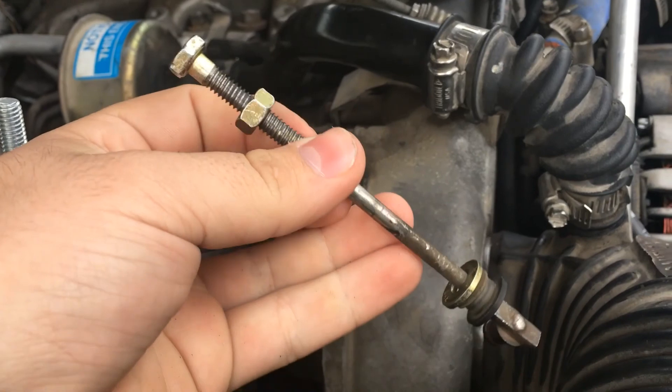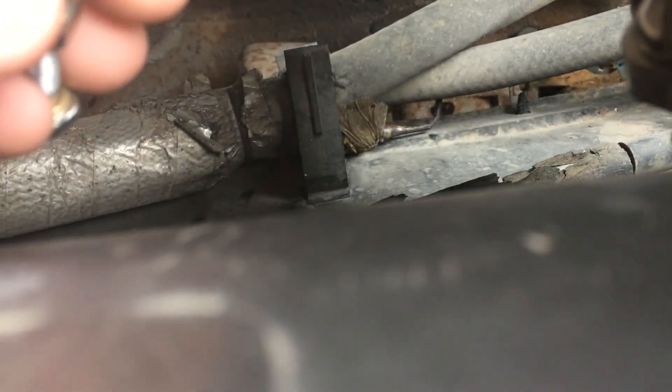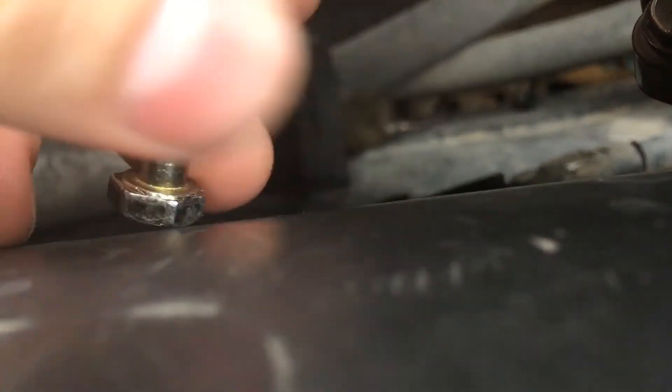Originally I did a different version first. I took the original controller arm that hooked into the wastegate on the turbo — it just had a C-clip on it — took that off and cut the pot off. What I originally did was thread the end of this, then drill a hole in a small bolt so I could thread the bolt together, put the spring on that, and use that to hold everything together. Then just add a nut, push it down the thread, and adjust spring pressure.